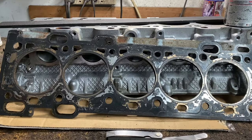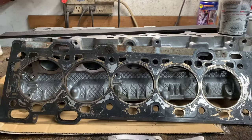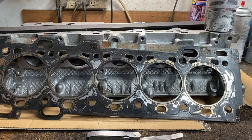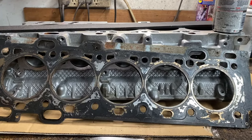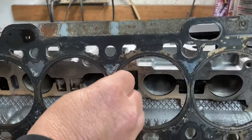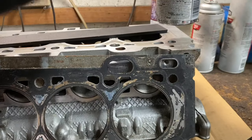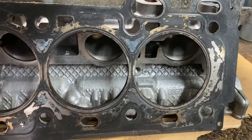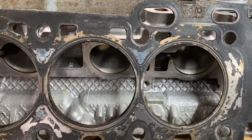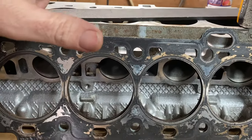These things prey on people's desperation. If the car has symptoms of a blown head gasket — if it's blowing white smoke or running rough — no head gasket sealer is gonna work. Nothing's gonna work except physically taking it apart. That's the only proper fix. Some shady mechanics or shady car dealerships, if it has a slight leak, will put this in just to dummy it up and sell the car. That's not the right way to do it.